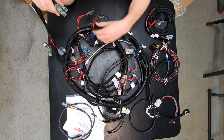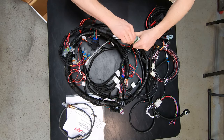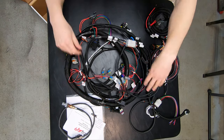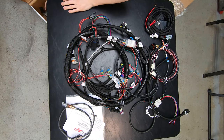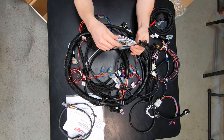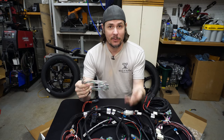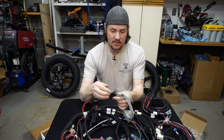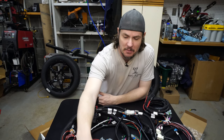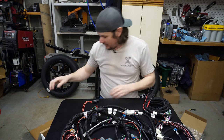Somewhere on the harness there's an injector plug — and it just plugs in like that. Then we've got two injector leads going directly out to our injectors. This is the optional harness — digital outputs, digital inputs, analogs, pulse width modulation. You've got eight total: four in, four out, and some are user selectable. We'll get into that especially when we throw nitrous on this, because we'll be using the nitrous program that's built into the ECM.